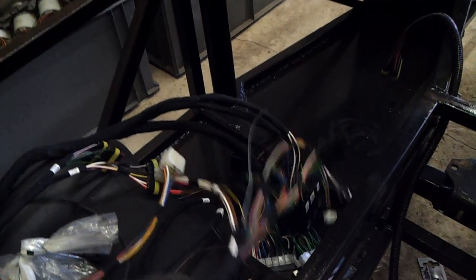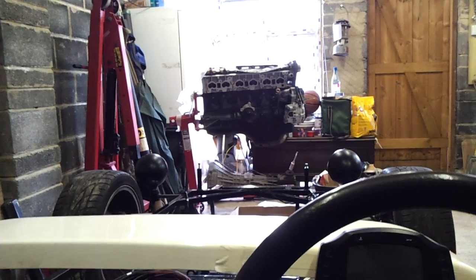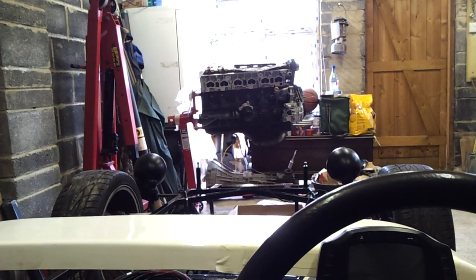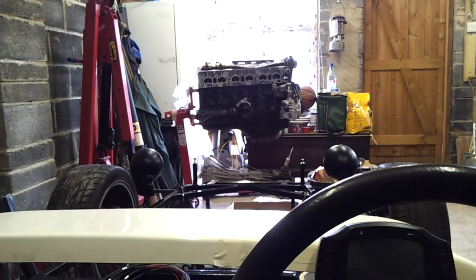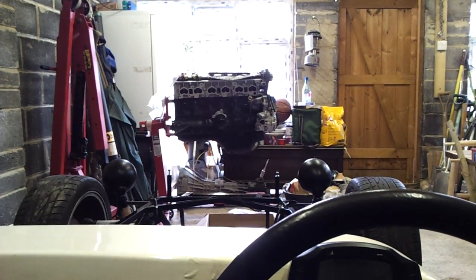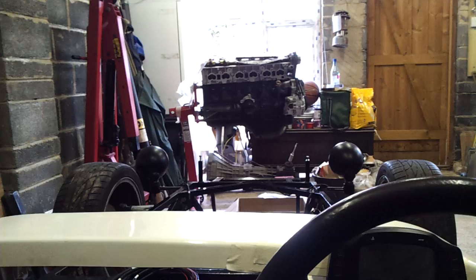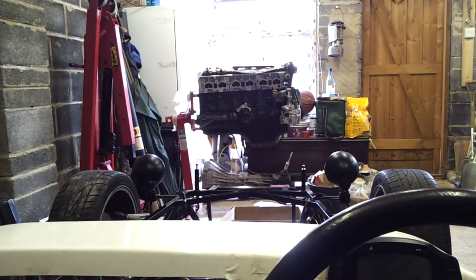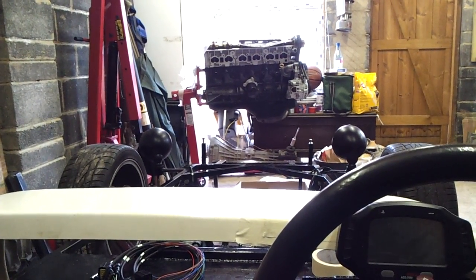I just thought I'd quickly do a little update. Over the next few days I'll be installing all this loom and getting it all in place. All the gaskets are now ordered for the intake and exhaust, so they should arrive mid-next week so I can finish off the engine build. I want to refit the sump with different gasket material — the non-setting stuff I had in there I'm not happy with, so I'm changing over to setting black silicone gasket instead. I also need to paint the gearbox. I'm going to refit the gearbox first and then put the engine in afterwards.